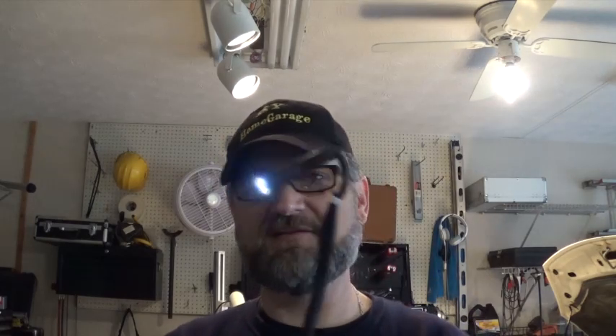It's pretty cheap, very effective, very easy to make. 20 bucks and another two or three dollars to put all this together, and you've got a very powerful diagnostic tool. You want to do this on a cold engine. I was playing with it yesterday and the engine was a little hot — the camera doesn't like the heat much. As I was going in and out, the camera got really heated up and it had a red glare around the perimeter. On a cold engine it actually looks pretty good, and the resolution is really awesome. For 20 dollars, you can't go wrong.